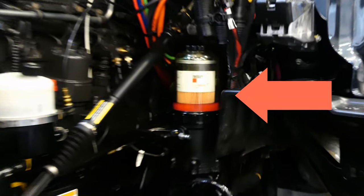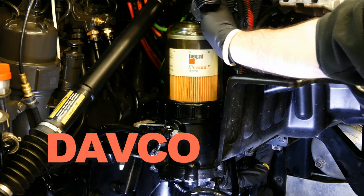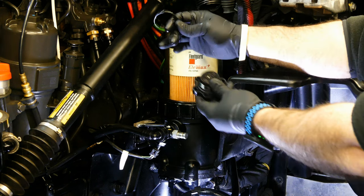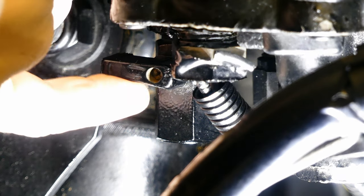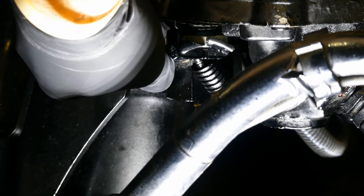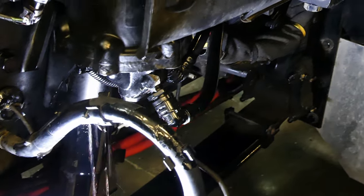In order to do a full fuel filter change we must include the chassis filter or water separator, so we'll go through that process first. This is the DAVCO style chassis filter where the filter and the bowl are on the top. First we'll remove the top cap — keep track of that o-ring — and then find the drain valve located below. This drain has a quarter turn lever on it, so once you turn it to the downward position fuel will start to run out of the bowl. Be sure you have something to catch the fuel as it spills out. Once the fuel is below the filter level we can shut off the valve and start filter removal.